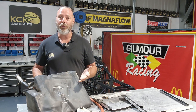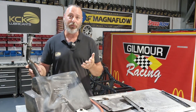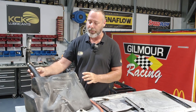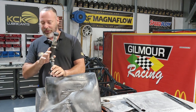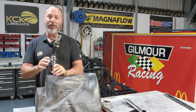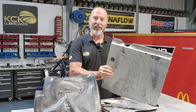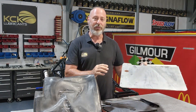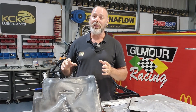The fuel tank we were supplied with the car was incorrectly stored at best. It was all cracked and actually leaked quite badly. You can see the filler and everything on it. It's actually got a cutout on this side for where the gear shifter goes down the side of the car, and even in some of the panelling you can see the hole where the gear shifter goes through. That's why we need to fit this thing straight up — it needs to be the absolute next thing we fit so we can keep assembling the components around it.